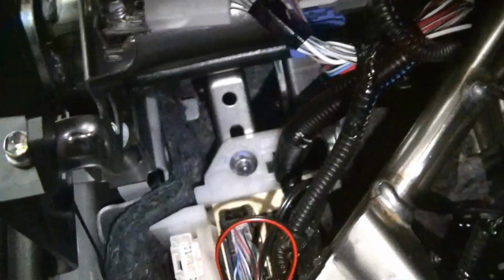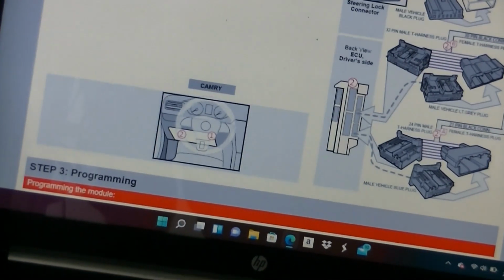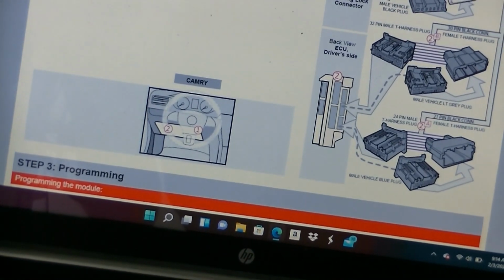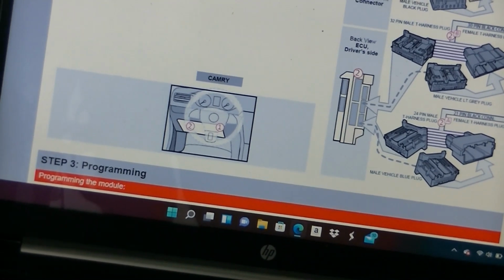We're going to find a place to tuck it in so it's nice and neat, and get it installed. Alright guys, so we have the harness in our hand, and it looks like the connectors that we're going to need are the 2 bottom right ones on the body control module. So we're going to unplug them, plug these basically in line, and start running the harness.